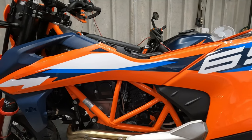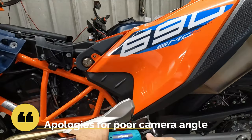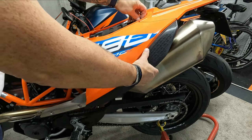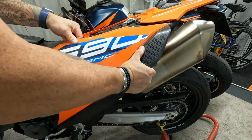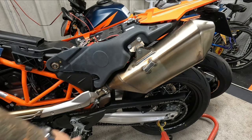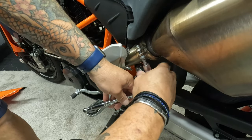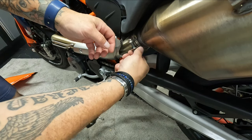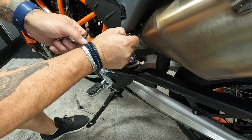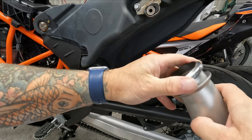That is going to be more than enough — if it's anything like the 701, that is enough. I wouldn't recommend running one of these without the baffle because it's absolutely horrendously noisy; they also recommend not running it without one. There's a link pipe, another baffle, a bolt, and some lube. You put the lube on the bracket, which eases fitment. So without further ado, let's get this swapped out. I'm going to start by taking these panels off. Done that panel — watch this top clip — and that just slides straight out. We've got the fixing in there and the clamp; the clamp is a T45, 45. Now we get the gasket off the original exhaust.